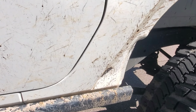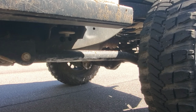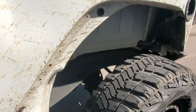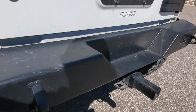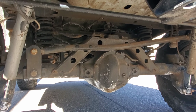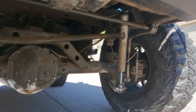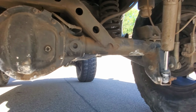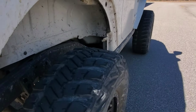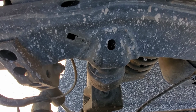When you go to stretch it, don't think that you're only going to stretch it 3 inches to save money, because it's all going to cost the same. It's a 3-link long arm, so you're going to have to do something to the suspension. I have seen people put longer arms in the stock brackets. I wouldn't advise it. The stock brackets aren't the strongest thing in the world, but people have done it and wheeled hard with it. If that's the route you want to go, let me know how it goes. Pretty much it's the truss, the 3 arms, and the cross member at the front. You will have to do a custom track bar bracket, which I did up here. You're also going to have to move the bump stops.